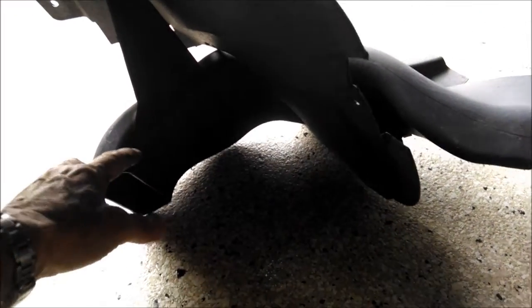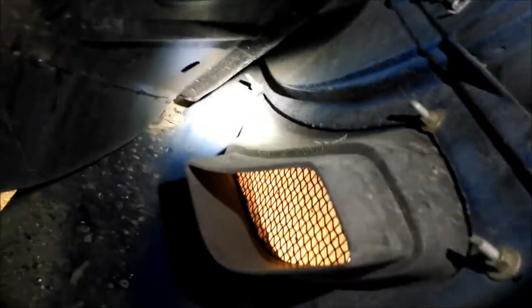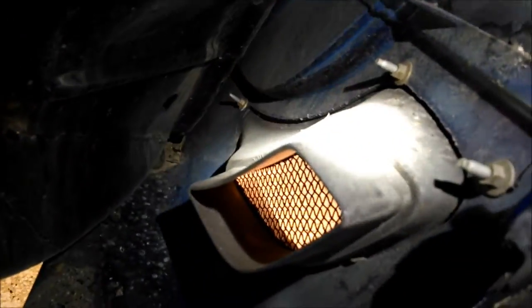It is as I suspected — you kind of get them both out at the same time even though they're two separate pieces. You drop back the back part, push in over here where the brake duct is, and that gets it away from this lip. Then once you get it away from the lip you just lift it up over. Now we have access to the back side here. There's one, two, three — looks like four — nuts, and then that'll come right out.